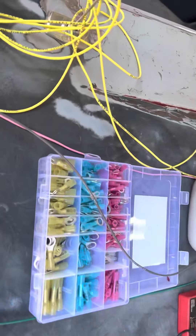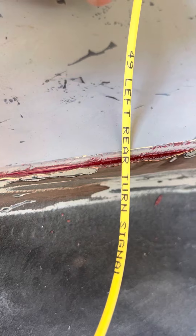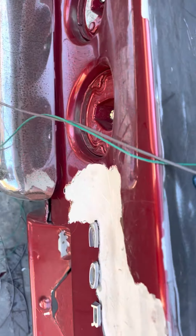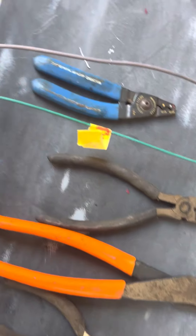Pretty nice harness except for the fuse box mounting. Some of these wires are really nice and thick — this one is super thick. This is the left rear turn signal; they're all labeled on the wires, which is pretty cool. You can just follow them no matter where you cut them. One thing I thought was kind of interesting is where they split for the left and right — that would be for the taillights. But here, for the backups, there is no split at all.